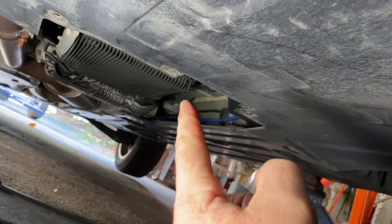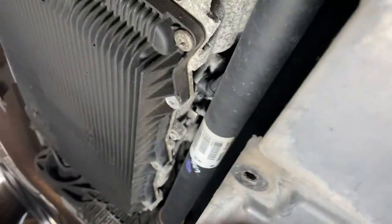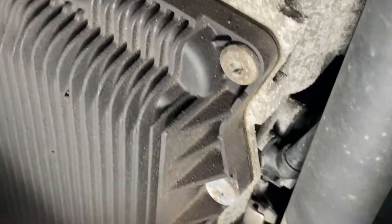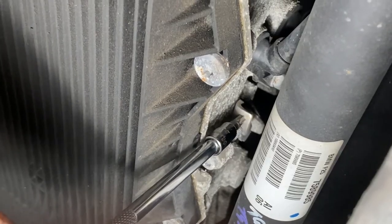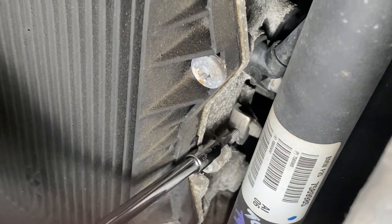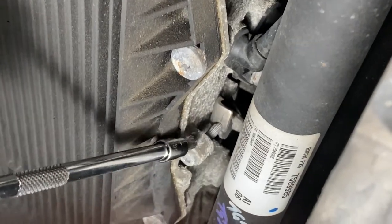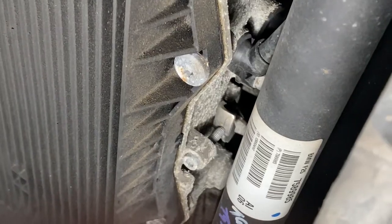The lever is on the driver's side right here. You take your 5mm allen — or T30 Torx like I'm using — and it goes right into this bolt. You screw it in and this lever pushes up, putting it in neutral. Right now it's in neutral because the bolt is screwed all the way down — the lever is pushed all the way up and it's nice and tight, can't go anymore.